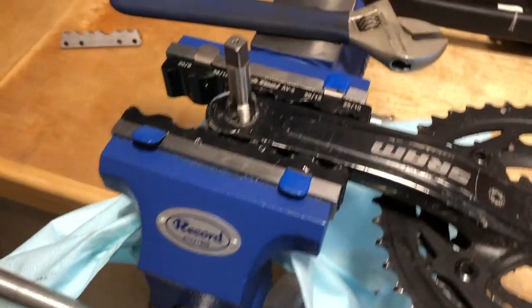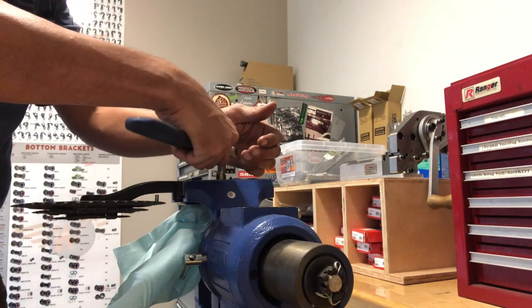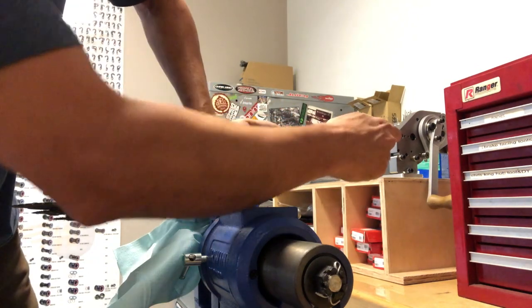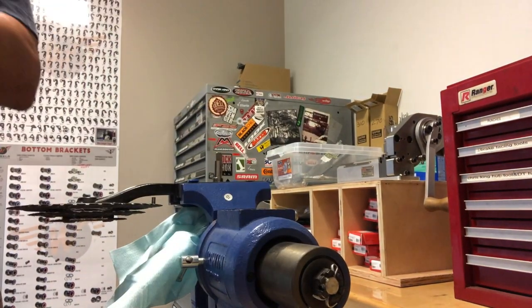You can see here I've got the little tap in there and the metal cleaned out. I started a video on this but just didn't record it right, so basically we're at the point where it's just a matter of turning the little tap until it reams it out to the thread portion. I put plenty of cutting fluid on it off-camera.